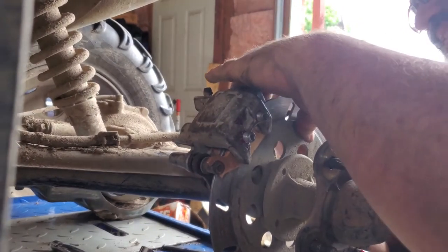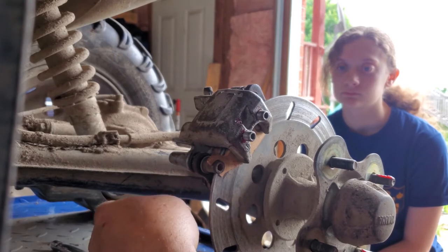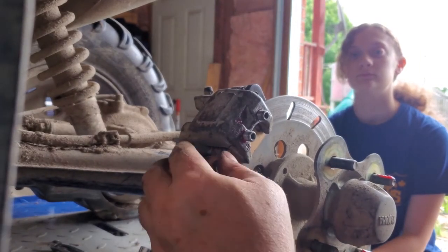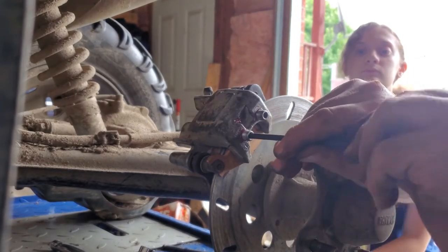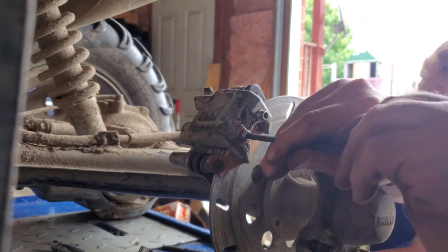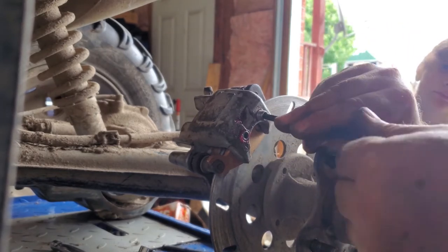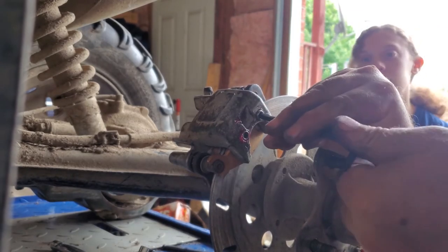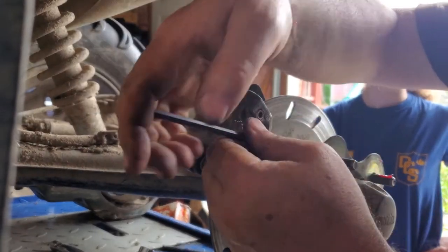Everything's back in place loose - now we just have to tighten up all the bolts. Do the bracket first because it's going to be wobbly and you'll be fighting with things if you don't have a tight bracket. I don't worry about torque on things like this. The pins were full of dirt, we cleaned them up, and we'll screw them back in - you don't need to be putting Loctite on these. I put a little bit of grease on the inside so the pads won't bind on there - they were pretty rusty so the pad didn't have the ability to move the way it probably should have.